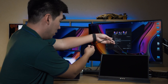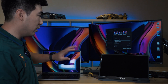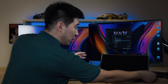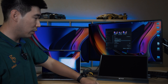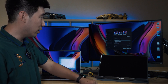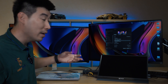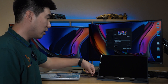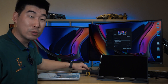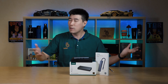I'm giving the portable monitor power via a separate lead. After connecting it to the USB-C port on the docking station, as expected, no third display appears. We only have the two displays showing — the third display is not recognised. Unfortunately, you cannot use a USB-C monitor via the front port; you must use the DisplayPort or HDMI ports on this 9-in-1 docking station.